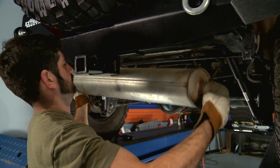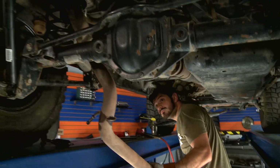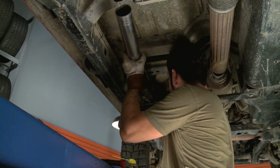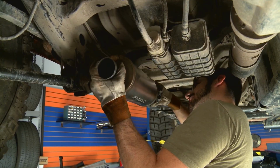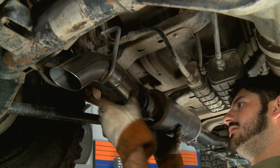This system will install on your Jeep very easily. That installation process begins by removing your factory exhaust system, which is done by removing a couple of clamps and popping a couple of factory rubber exhaust hangers loose. Once you have that factory exhaust removed, you can go ahead and install the new one, leaving all of your clamps loose until you have everything lined up and in those factory hangers,